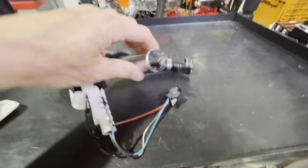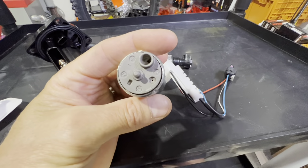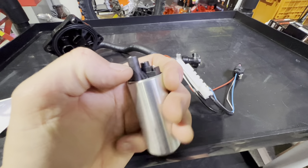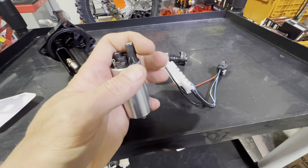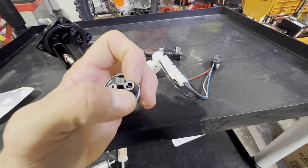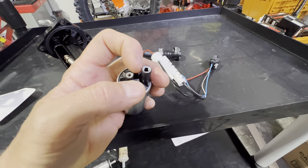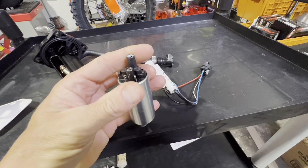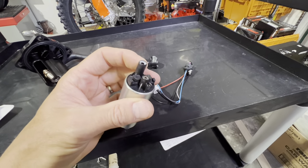Back to the motor — this is a different motor than the previous gen; they are not interchangeable. Everything on the bottom is the same, but up at the top you have the outlet port. This does not have a hose connected to it, so there's no load-bearing happening with the outlet port. This is like a little Schrader valve — basically a one-way check valve that prevents the pressure from bleeding back through the system to the injector. So if you shut off the bike, you retain that fuel pressure. It will bleed off slowly over time — in a few days — but it will absolutely hold for many hours if not a few days.